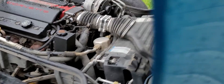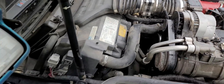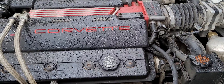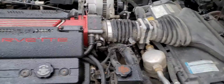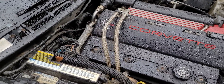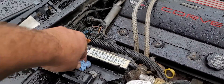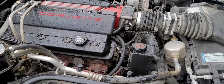Even in my case, I had literally just a tiny little valve that was leaking - and not even leaking that much. But what it was doing was allowing air to enter the system, and it would boil over as I was going down the road, almost pegging the temperature gauge. The fans were coming on where they were supposed to, but if you're not watching this you're going to get caught in a bad situation. That's why it's important to understand that everything on these cars is fairly complex - it's not just a simple radiator system; it has a lot of moving parts.